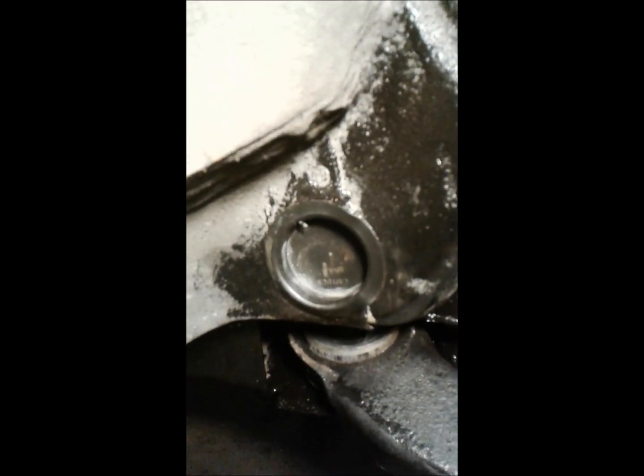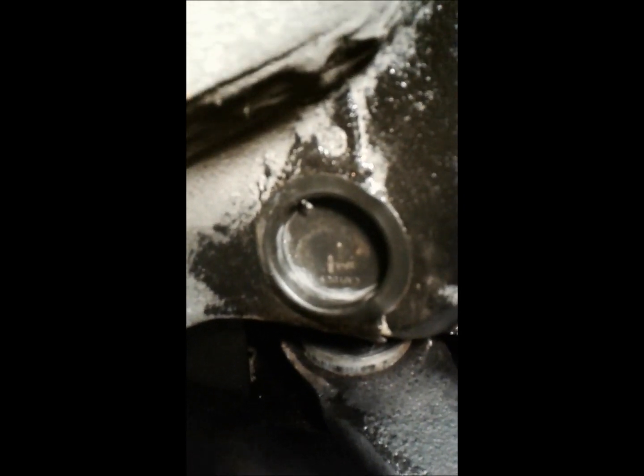So another step is those holes we cut with the hole saw so we could heat up the cap nut inside the frame. Well, look at that. That's why I used a hole saw, not a cutting torch like I've been known to do in the past. Just make a nice clean round hole and you can pop a cap plug in it. That's a 1 5/8 cap plug. I used a 1.5 inch hole saw, which usually cuts a little bit bigger than the nominal measurement anyway.